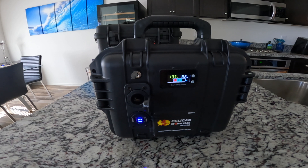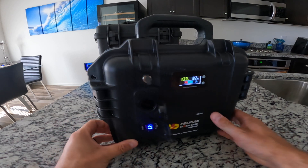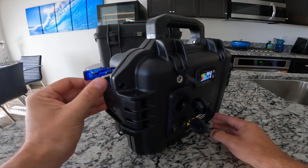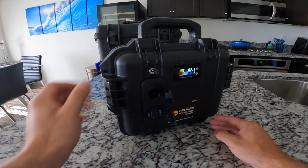I'm guessing it's going to last about 14 hours. The Dometic fridge pulls anywhere from 0.8 to 1.2 amp hours, so at an average of one amp hour it'll last about 20 to 22 hours. I also have a USB charger and a USB-C charger, and I wired those to the switch so when the switch is off, the ports go off too.